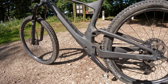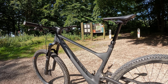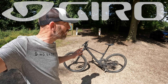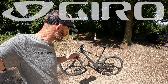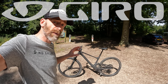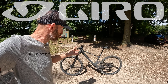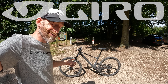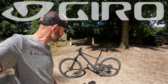There's a real win in terms of tire spec on this bike because you're getting an Addix soft compound version of Schwalbe's Wicked Will tire in a really supple casing — it's still an 805 gram tire, so not crazy lightweight — but for a tire with decent tread, the front grip is really impressive while still rolling fast. This Wicked Will is right up there. Unfortunately, this Scott Spark is the only place you can buy it — you can't buy it separately through normal channels until at least 2024. On the back you've got the same tire but in a fast-rolling Addix Speed Grip compound, which is what you'll find as standard in the shops. They've done a really good job convincing Schwalbe to produce a special tire just for this bike, and unless it's really sloppy and slippery, they are pretty much the perfect rubber for this ride.